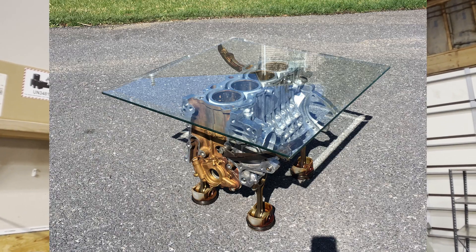Now that I know what I need, I'm going to get some stuff ordered — main bearings, rod bearings. I'm going to check out these pistons and see if they have the extra oil holes for the 2003-and-up 1ZZ engines. If they do, I might try to clean them up and reuse them. If not, I actually have an old 1ZZ that I turned into a coffee table, and those pistons are definitely from a 2003-and-up, so I may use those. I'll order a new ring set, I already have a head from a Celica that should be good. I'll get a head gasket, valve cover gasket, crankshaft seals, timing cover seal, water pump, alternator, starter — everything to get this thing not only running but also looking pretty. Time to go spend some money — I'll see you guys in the next one.